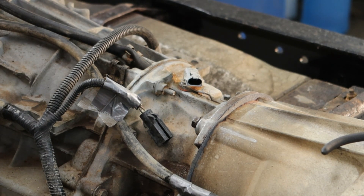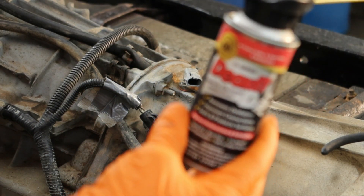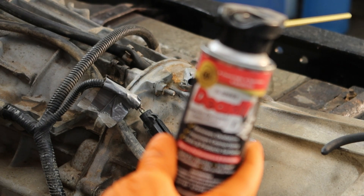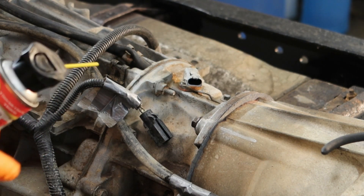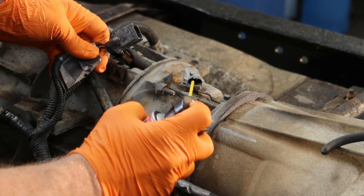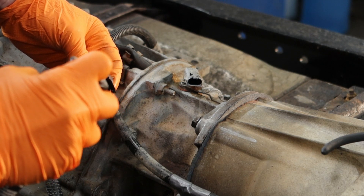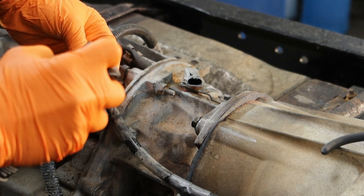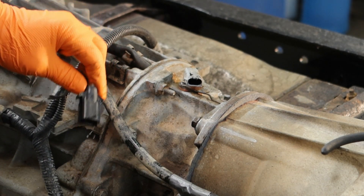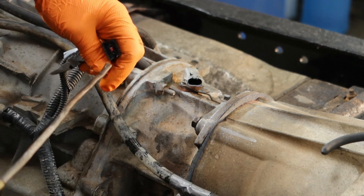This is fast-dry — it flashes off really fast — so make sure it's dry. Then, step two, we want to hit this with some Deoxit. I'll put the link down in the description. Spray it down with some Deoxit — this is going to take any type of varnish, any type of greening, and eliminate it. Once you've applied the Deoxit, blow it out again.